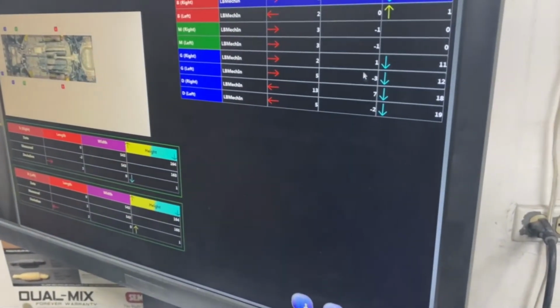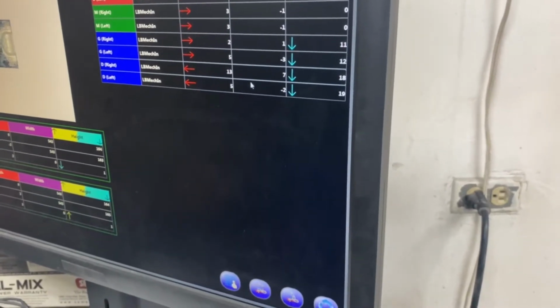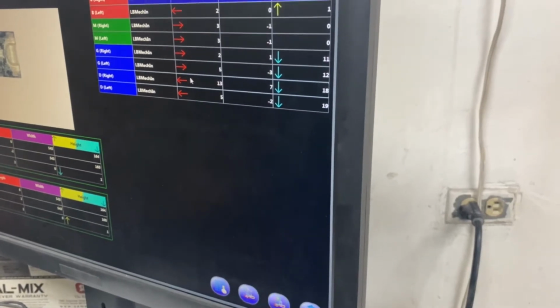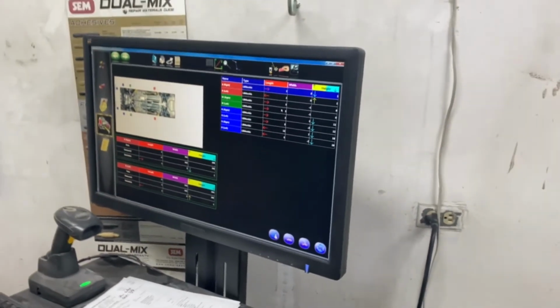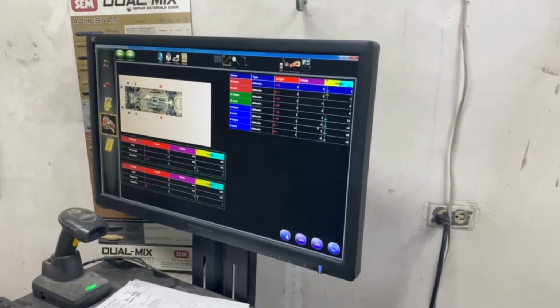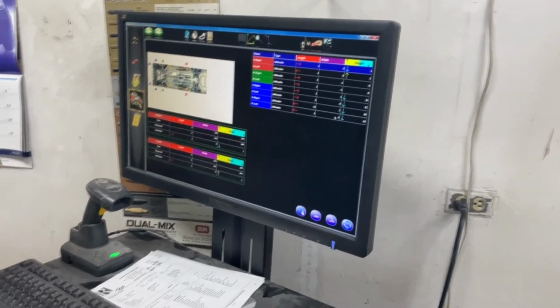These 2 points are within tolerance. I'm allowed 3 to 5 millimeters. These 2 points on my width is what I'm going after. My lengths I can't change. It's saying that this right rail is long. Well, that's the way the car was welded together at the factory. Of course, you got a little diamond here, it's going to reflect on your numbers down here. So now what I'm going to do is pull the rebar off and do one rail and then do the other.